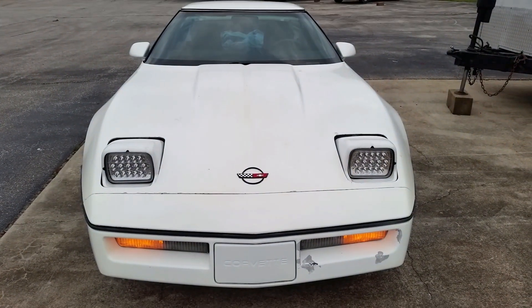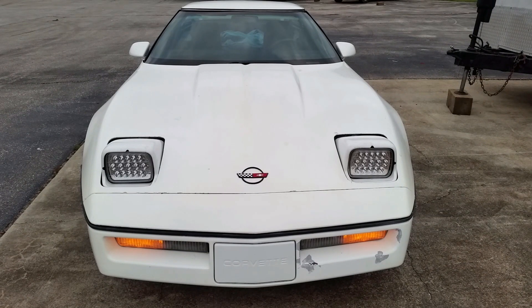So these LEDs are basically a budget-friendly option at $50. They have 15 3-watt chips. The color that you should expect is about 5,000 to 6,000 Kelvin. The lenses are a plastic material called PMMA. On the lens, they actually say DOT. They are rated at 50,000 hours of life.